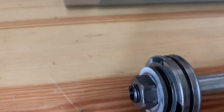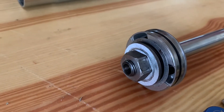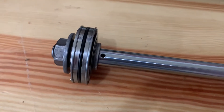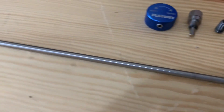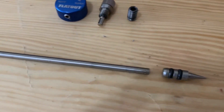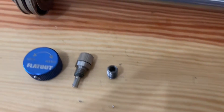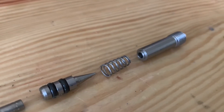The other side is at the very bottom of the shock shaft. Oil goes in. Oil comes out. When you turn the knob, it's moving the metering rod up and down, pushing against this, which acts to block this port and this port.